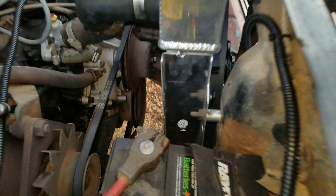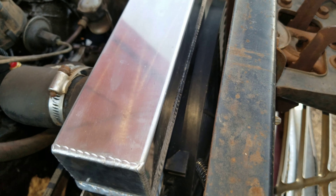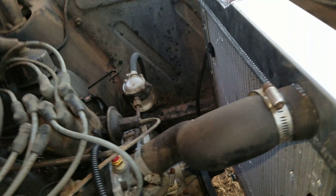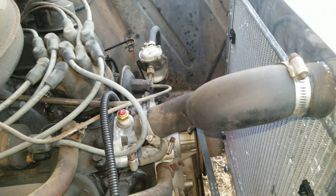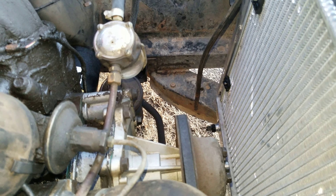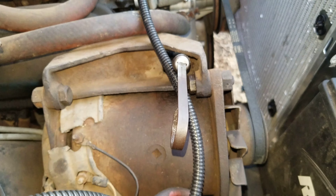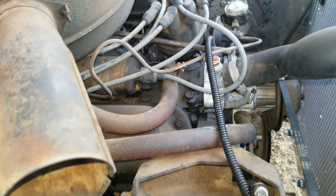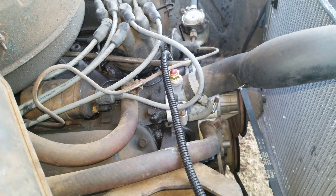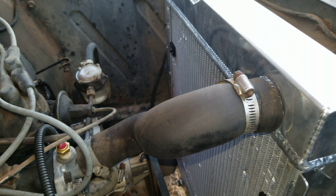I had to space the radiator off the original mounts and make it a pusher fan. If you try and run a cheap 16-inch fan on a radiator like this in this car, it will hit the water pump. There's probably a short water pump you could try, but then it probably wouldn't fit with the generator. It might fit with an alternator conversion and a different crank pulley, but at that point you're going a long way just to fit an electric fan in a conventional style.